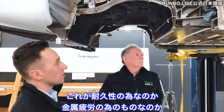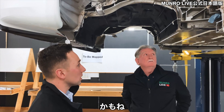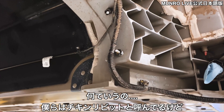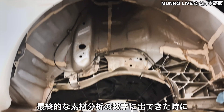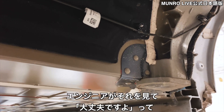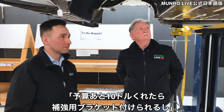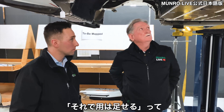It's hard to say if that's from durability, fatigue, or aiding in fixture. It looks to me mostly like dissimilar materials that need what we call 'chicken rivets.' You use them because the numbers show up on the FEA — the finite element analysis comes back and says it's OK, but the engineer looks at it and says, 'For ten bucks I can buy a bracket, and for a buck more I can throw some rivets at it and feel more comfortable that it's all going to do its job.'